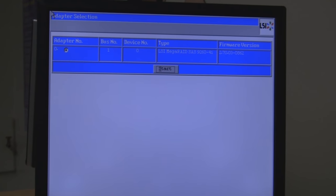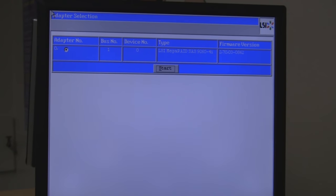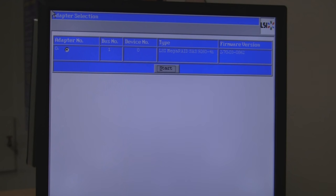It's very ugly — not pretty — but it's typical firmware for a RAID controller. You'll get in there and do simple mirroring and a couple different kinds of RAID configurations. When we get the laptop hard drives, you'll probably do a couple of RAID 5s. Once you're familiar with the PERC on the Dell and you've done a couple of RAID configurations, you'll find this one no more difficult than the others.